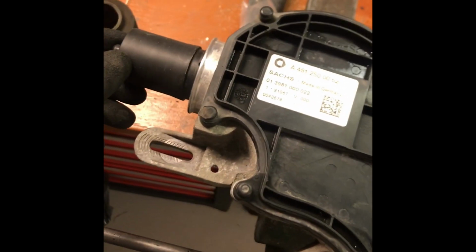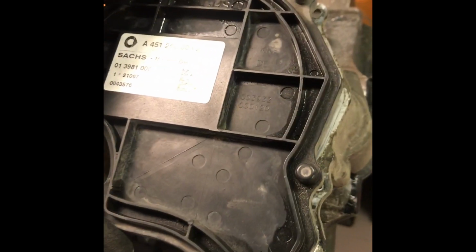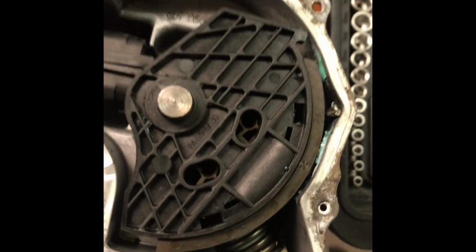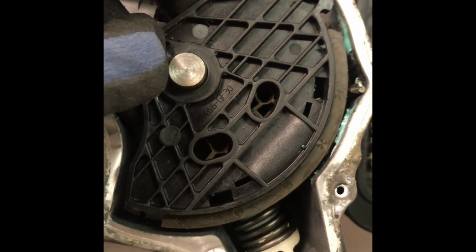In this case we got 3 lines up on the dashboard, which indicates that there's some problem with the clutch and gear. And what I found out by just simply taking this cowl off, it says on the side not to take it off because there's spring-loaded equipment in here, but it doesn't really matter. You can see here it's a small axle. It's actually broke off, and this axle is connected to the motor, a small electrical motor that will actually work this equipment.